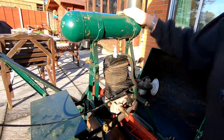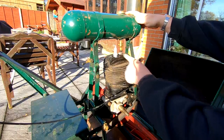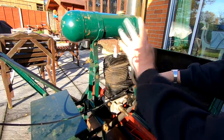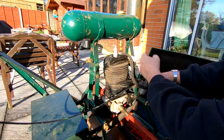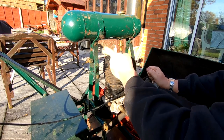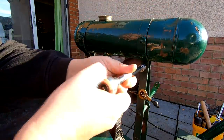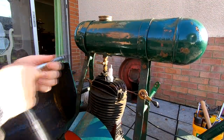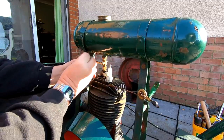Right, we're out at the lawnmower now. One thing I want to address first is the fuel tank, which appears to not be shifted over enough - it might even be on the wrong way around. If I push it forward to where it needs to be, that tap is going to be hitting that bracket, which I don't think is right. Whereas if I spin the fuel tank around, the tap will be over this side in the open area. So I'm going to undo the brackets that hold that in. These two nuts here - they're not even tight. There's no way I would have put that on there resting on the cylinder head like that.